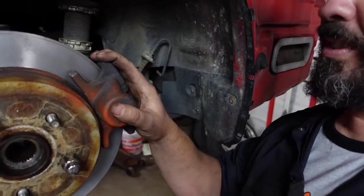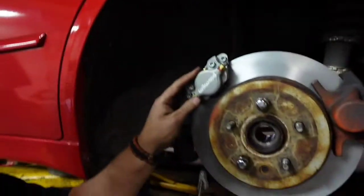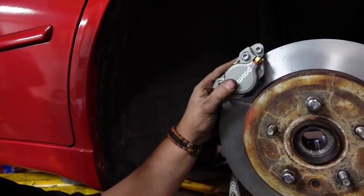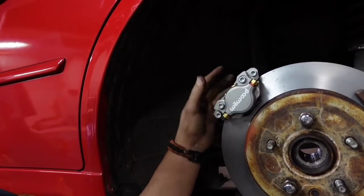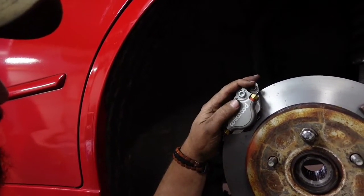I think the rotor's still a little off — it's actually this rotor making the noise. I went ahead and waited to change the pads so they're still tight and the mechanism is pushed in, but there's no noise from it. I still need to change the pads on this one — that's what's making the noise. Once we do this, we have to run the lines to our second caliper, then go back under the car up to the e-brake, and we'll do that on both sides. Then I'll mount the hardware and get all that installed.